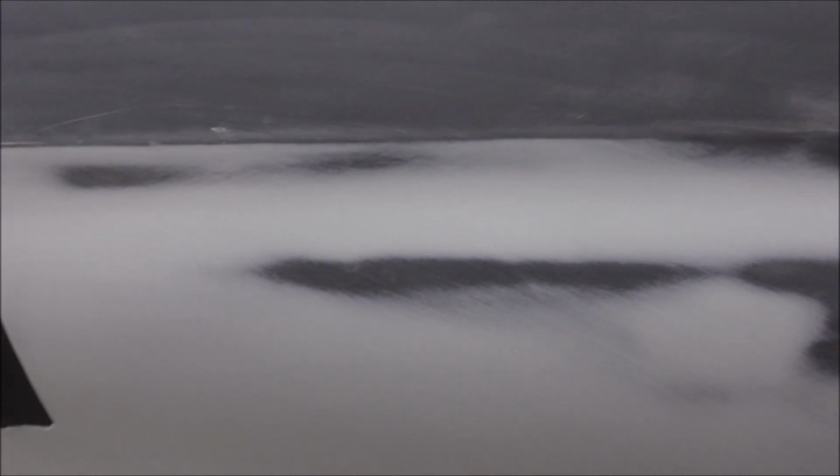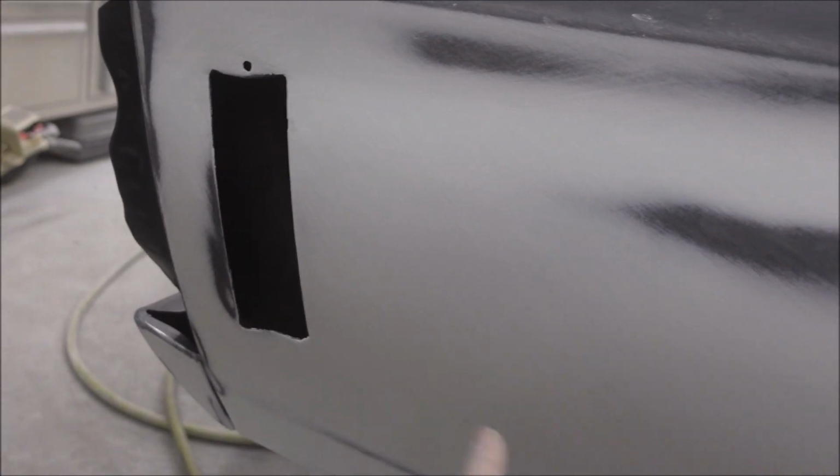So I kept sanding until I started going through more areas. You can see where the lows were. Basically, you don't want a bunch of filler on there you don't need. So you only want as much as it takes to get it straight. A lot of times you'll strip a car and it'll have tons of filler on it, and you get it all off and you're like, why did this have this on there? I didn't need it. So you can see it needs it because of the way that it is.